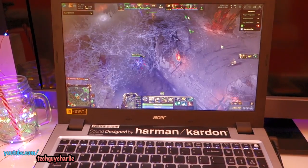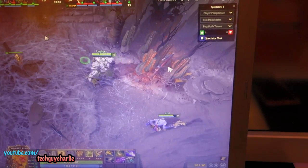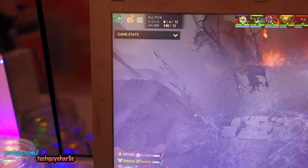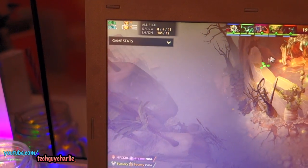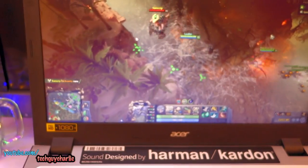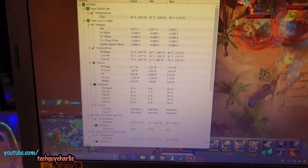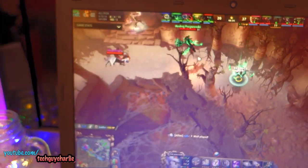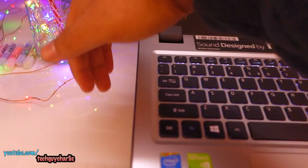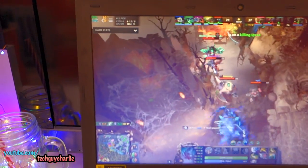The game has been running for about half an hour now and absolutely no issues — no more thermal throttling. The frame rates are hovering around 28 to 40. The game is running at maximum settings and this is just a GT940M. The maximum CPU temperature I've seen is 81-82 degrees and the GPU hovers around 70 — that's about a 19 degree improvement since it used to touch 100 degrees. This little project has been a success. Thank you for watching — stay tuned for more videos like these!